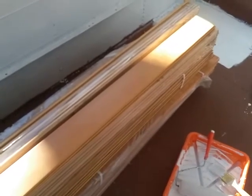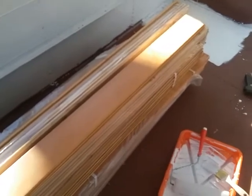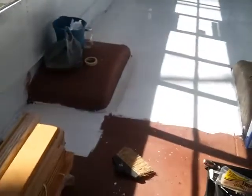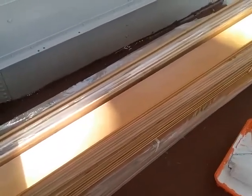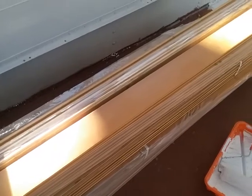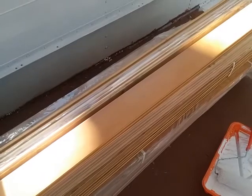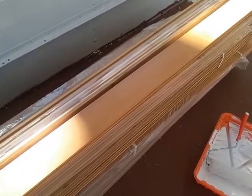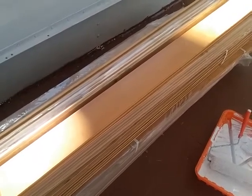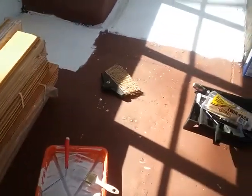It's not like the snap-on type. And it's trackable, so it has all those things going for it — which are great for this bus. So I'm going to reduce the thickness of the plywood to like quarter-inch, and then hardwood floors the whole floor. That will give me an inch of solid wood flooring, and then insulation underneath it — another inch of insulation. So yeah: one inch furring strips, one inch insulation, quarter-inch plywood, three-quarter inch hardwood — two inches of floor. And that will be perfect.